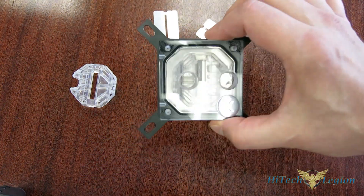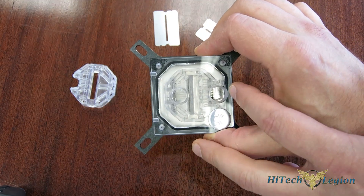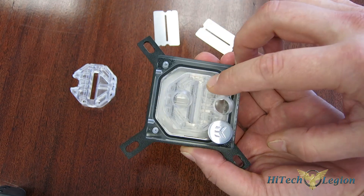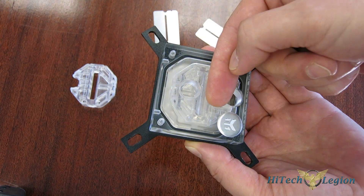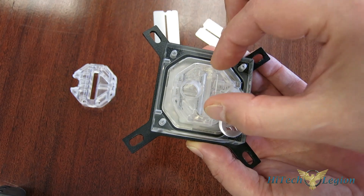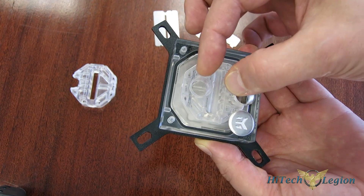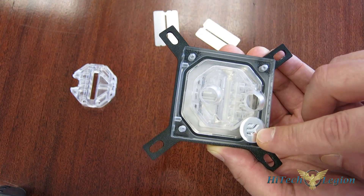Taking a closer look at the Supremacy EVO, you've got, on this particular unit, the clear top — could be black, silver, or colored as we said. You do have a dedicated in and out port, and there's a reason for that. The in port, as you can see through the clear top, has a channel — when the liquid goes in, it comes down through the channel and through the jet plate, centering the liquid on the hottest point of the CPU itself. That's why you have the different inserts and jet plates, which spread out or minimize the flow of liquid depending on the size of the hot point of the particular CPU.